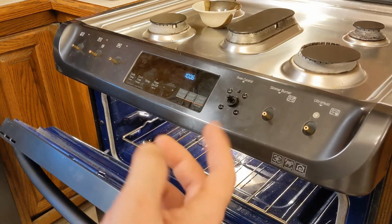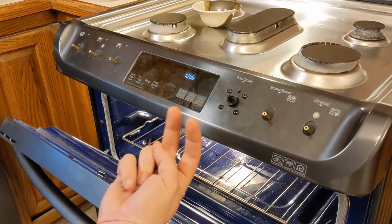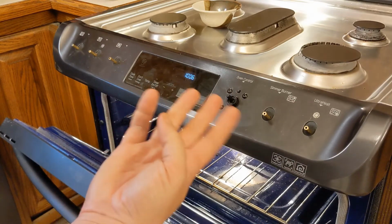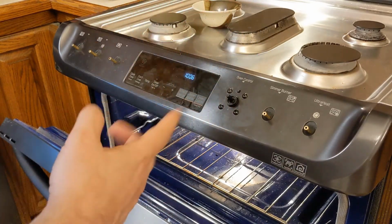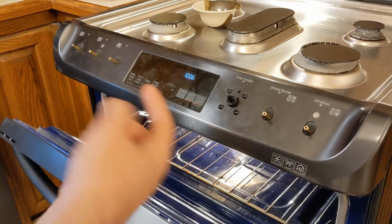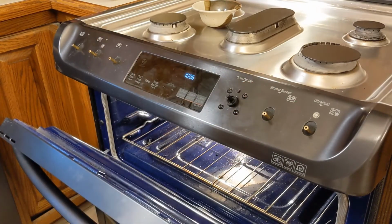Alright, I took it apart. Had to get those wires back up in. Thing to note, the 2 screws that come in from the bottom here, put those in while you have this up on the countertop. Otherwise it's real pain to see the hole to go through. So assemble those 2 before you get it up here.